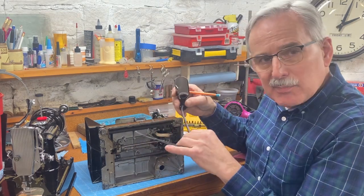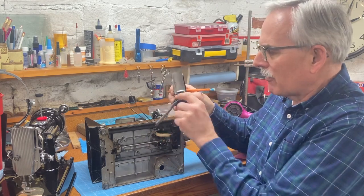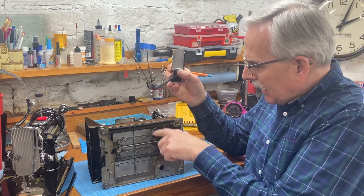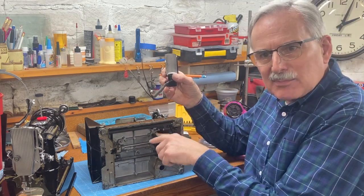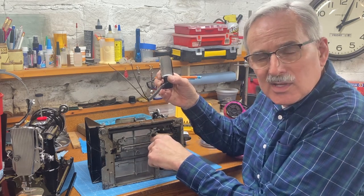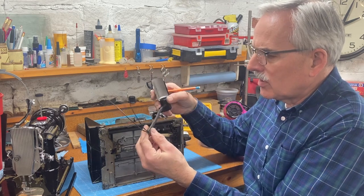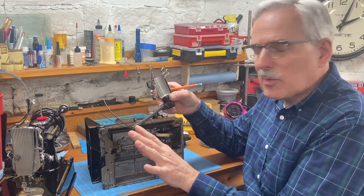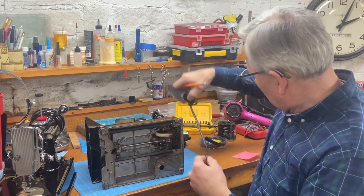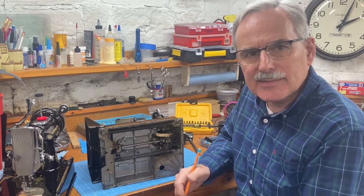And that's, in my opinion, better than what some of the other replacement light circuits have, a plastic jacket on here. Well, the plastic jacket is very flexible, and I have lower confidence that that plastic jacket is going to stay in place and never come in contact with these gears. So that's why I do that. So I think it's a great solution that means there's no exposure to lead, and yet the wires are thoroughly encased. So those were a couple things I wanted to talk to you about today.